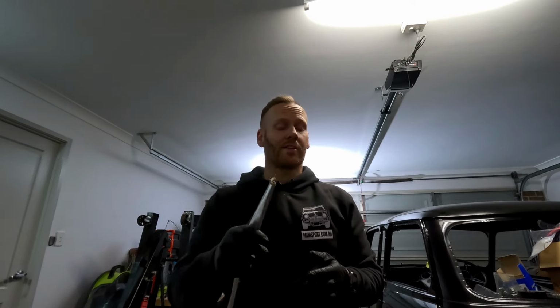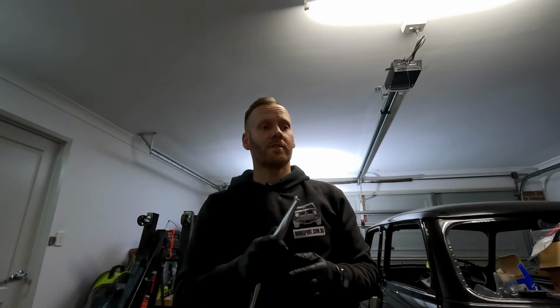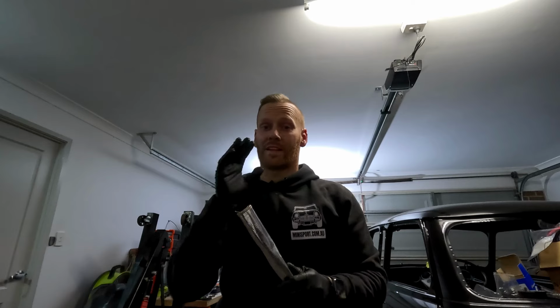Brake fluid generally doesn't boil, but it is hygroscopic, which means it attracts moisture. Once that moisture gets in there, that's it, game over, done, see you later. So that's why it's important to change brake fluid on a regular basis. By regular, I mean generally every 30,000 kilometers or 2 years, whichever comes first. We actually had a car the other day, quickly off topic. It had done 24,000 kilometers in 14 months and it needed a brake fluid change. And we did it exactly 14 months ago, or 24,000 Ks. So it is worthwhile noting to make sure that you change brake fluid for that exact reason.